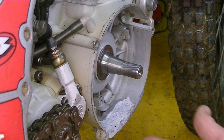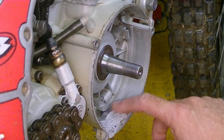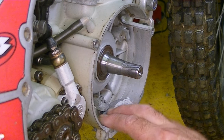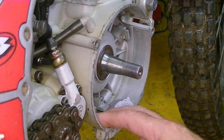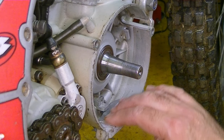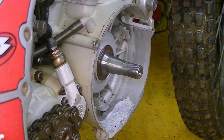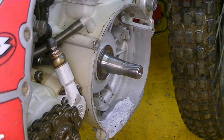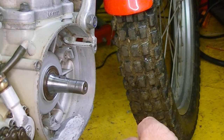At some point the bike took a real knock and it actually knocked a hole in the bottom of the casing. What I've been doing is filling that and building it up with some metal putty, and that's just where I've sanded it down to make sure the flywheel clears it — but I've built it up at the bottom so it will seal. I strongly suspect that's the reason the stator failed, because I think water and dirt got in through the damaged casing and damaged the coils. Anyway, I've fixed that so hopefully we'll get a nice tight seal.